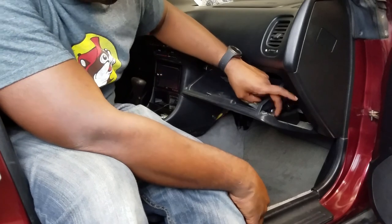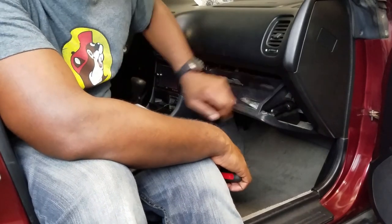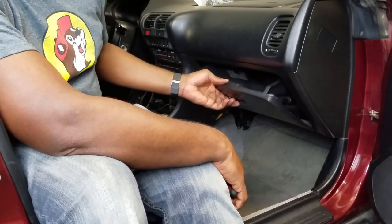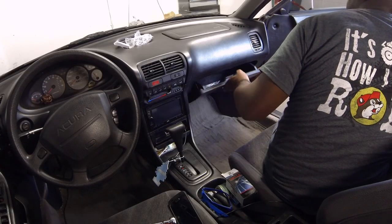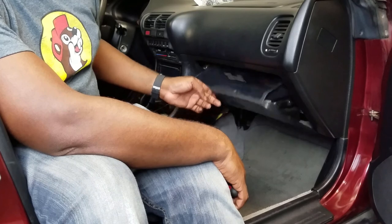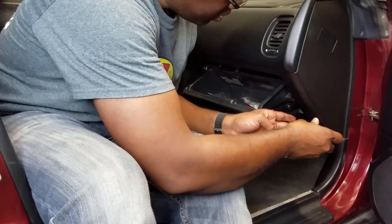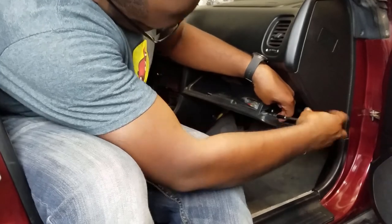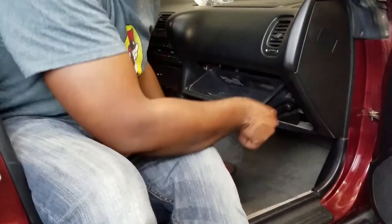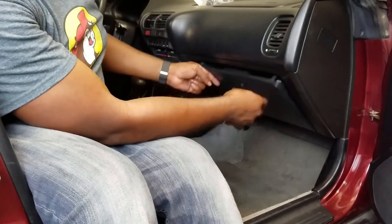While we have this open, the next step is to remove this little screw here — this screwdriver screw that goes into this shock absorption type deal right here. All this does is act as a shock absorber or dampener to dampen the throw of this glove box. Luxury car manufacturers install this so that the glove box doesn't just fall down. It's connected to the actual car chassis, and you want to remove that — it's going to be a hindrance if you don't get it out now. So I'm just going to unscrew this. Just a regular screw — here's your damper. Pull that out, and now it's not dampened at all. You can see how fast it drops down.